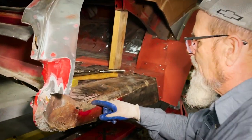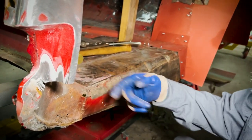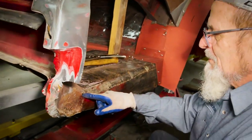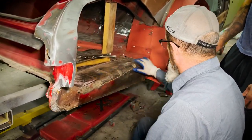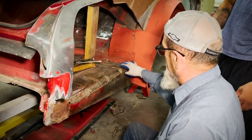I was just going to get the grinder to clean out this area and see what's under it, because if it's like the rest of the car where the Bondo was, it's holes. So we're going to cut it and bring this over. I might make an angle cap and just recap this whole thing from inside here, because it's only a series of bends and that would probably be cleaner.